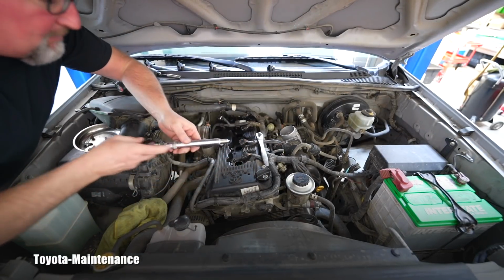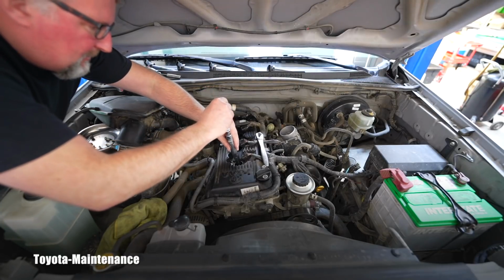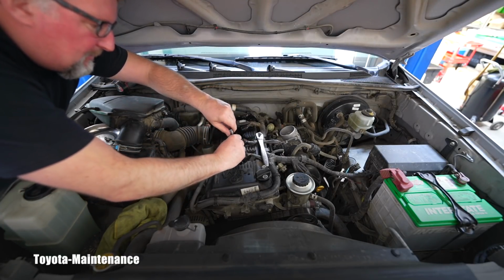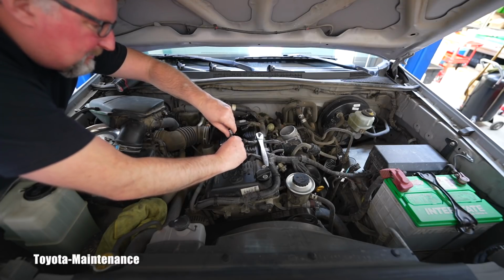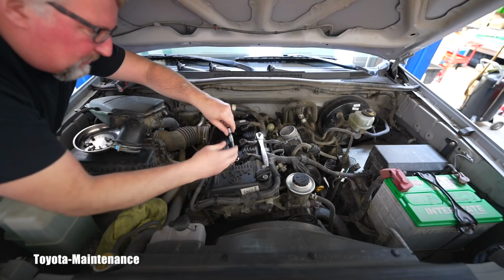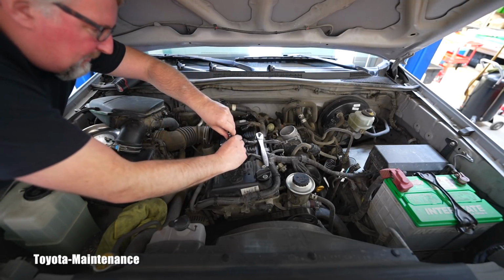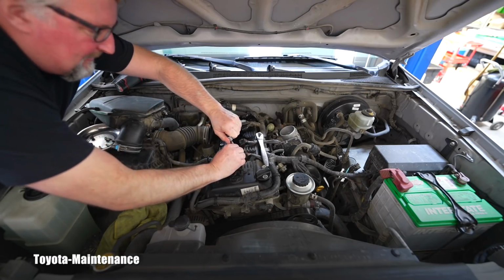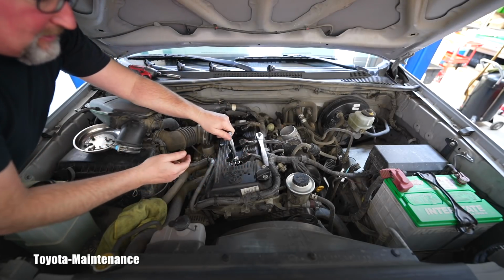So let's see what they say on that box. I have that new spark plug. I will carefully, without hitting anything with the tip. These tips are very fine, so you don't want to do it too fast. And I will use my hand only, right? They say hand torque it until it stops and you cannot turn it anymore. So you see, this is a long thread. It takes quite a while to get it there.